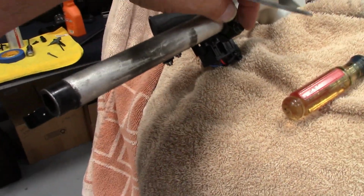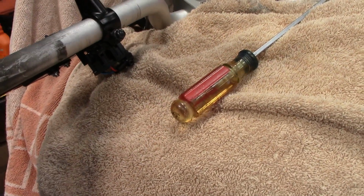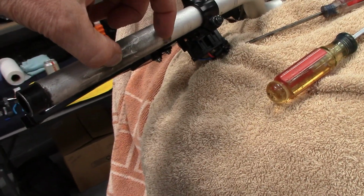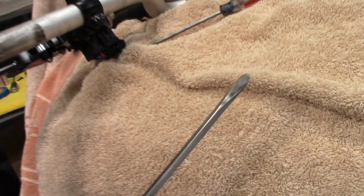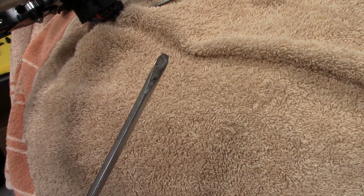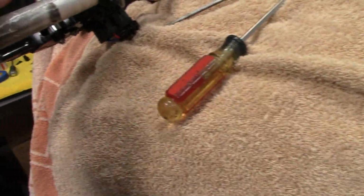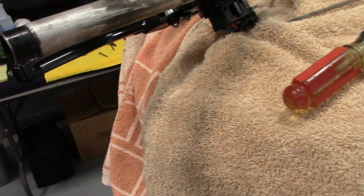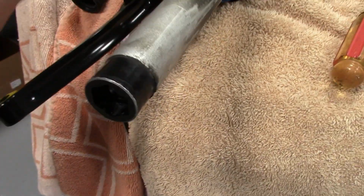So I loosened this clutch perch up and slid it in. Then I was able to get it as far as I could with the little guy. And then there was about 1.5 to 2 inches in the center I couldn't get with the little one. I have a screwdriver that I tapered down that I use. Get it in there very carefully and work it. Keep spraying your stuff. Don't poke it through. And then it breaks loose and came off. I was able to get the grip off just barely enough without loosening the bars yet.